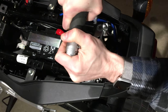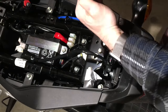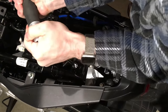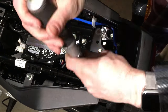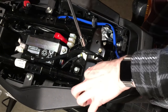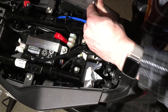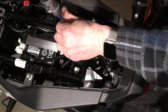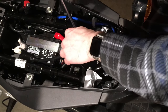Use a 12-millimeter ratchet to undo the factory fender. It is incredibly tightly attached, so these 12-millimeter bolts are hard to remove. You can see how the bolts break free with the Nebo tool. Once they're loose, remove all four bolts and set them aside. You won't be reusing these, but save them with the original hardware in case you ever want to reinstall the OEM fender.